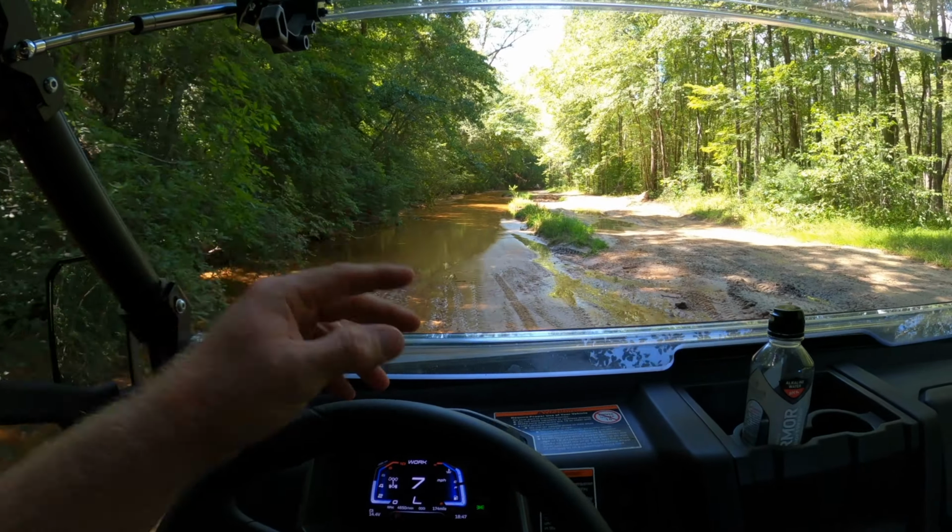So I'm running the Moorhead off-road front arms that you can only get at Main Street Cycle for your CFMOTO UFORCE crew cab and regular cab. And with these 32-inch tires, I'm sitting up at a little over 17.5 inches of ground clearance. So that's pretty nice. I do have the rear sway bar off, as well as 2.5-inch wheel spacers in the rear, just to give me some more flex and stability so that it's not real tippy. I like this setup right now.